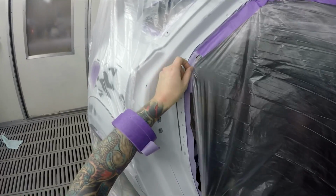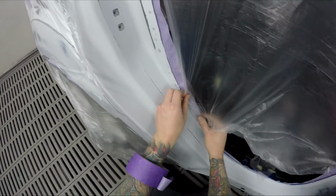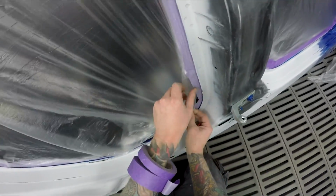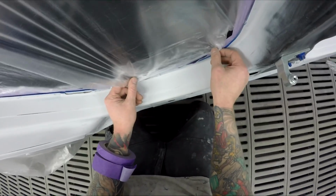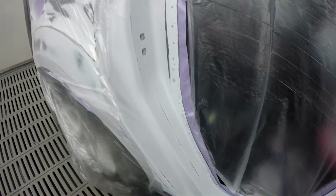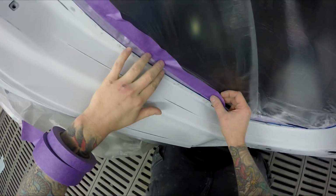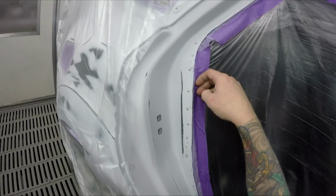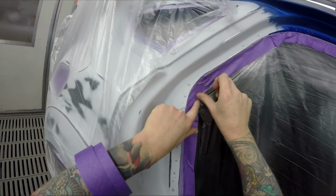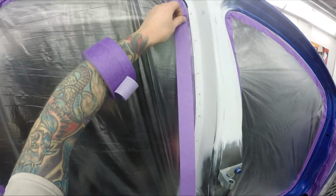But that's the point I was trying to get to: the LS Supernova, which is the HVLP version, actually sprays clear really nice, man. Really nice. It's nearly un-HVLP like, in a way. It doesn't spray like any of the other HVLPs I've used. It doesn't leave you with that big, chunky, ugly orange peel. I mean, it can if you want it to, obviously, but it's definitely on par with the Pro Light as far as efficiency goes. So it is probably running 130-140 mils per panel, depending.